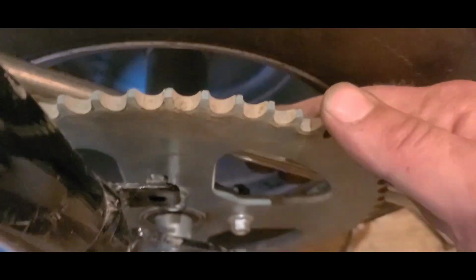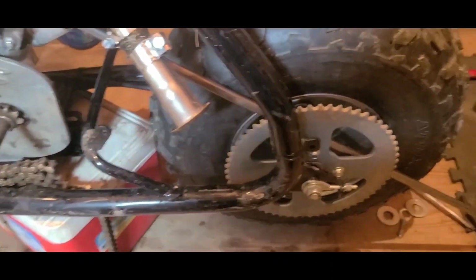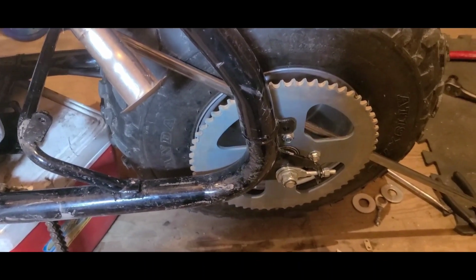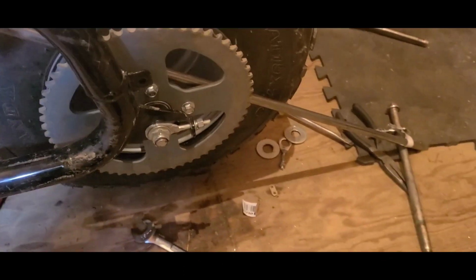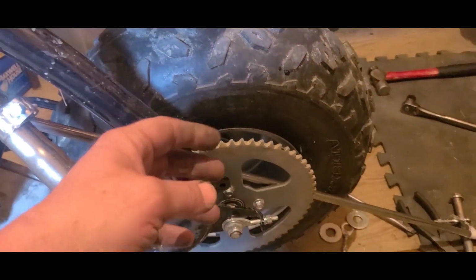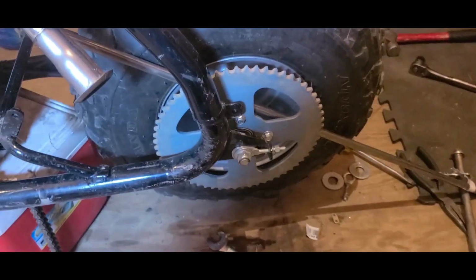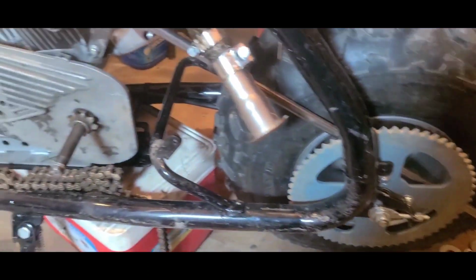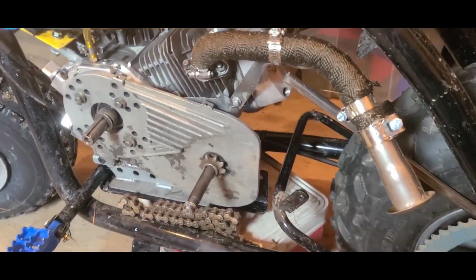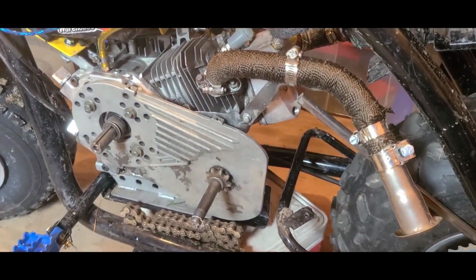Okay, went back to the axle and stock spacing. That seems to have fixed the lock braking problem. Obviously I'd rather do the washer and longer axle, see how you run out here, and run it the other way. That way I don't have to change the tire. Everything else will be the same. That means our issue is going to be somewhere up here.